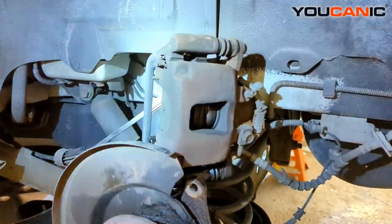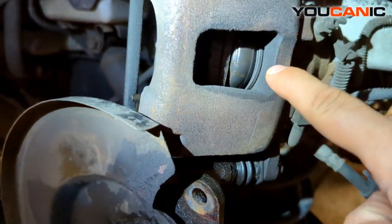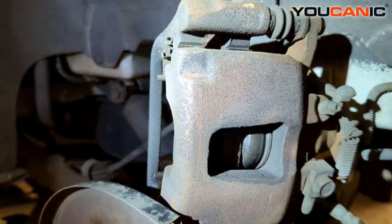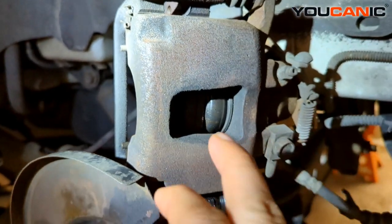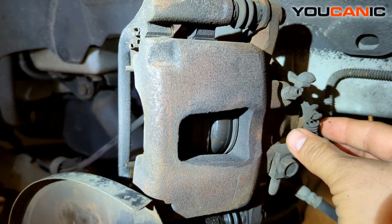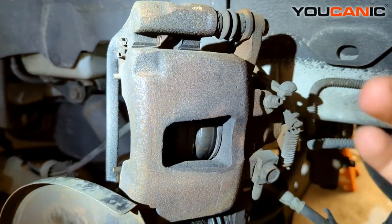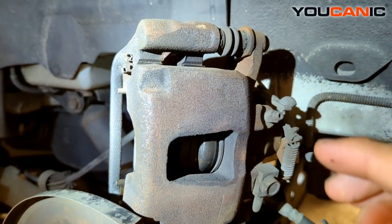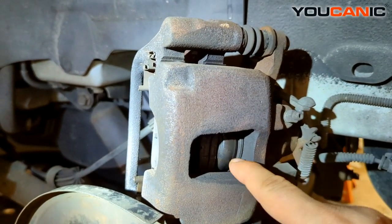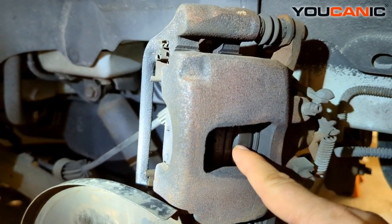This Eco is losing brake fluid, and if you look carefully here you can see brake fluid right here — it's actually leaking from the piston. This is the piston that pushes the brakes out. Normally, the piston moves out and fills the back chamber with brake fluid, which is why the reservoir level drops to the minimum. But in this case, this rubber boot is actually filled with brake fluid and pressurized — there should be no brake fluid there.